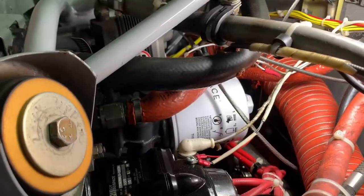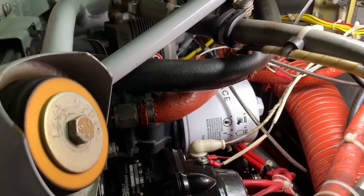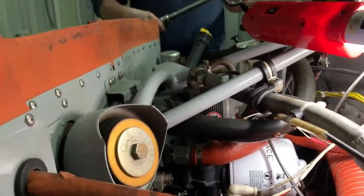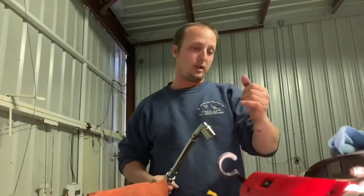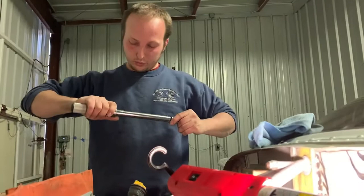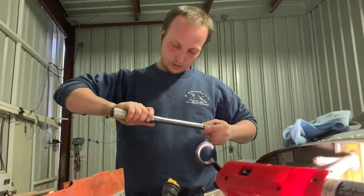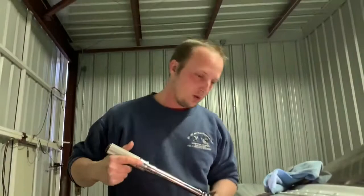Now I've got it started and screwed down where it's touching — I'll grab my torque wrench. The only thing is I don't have one anymore; I got rid of mine when I stopped working on cars. If you're going to be doing your own oil changes a lot, Aircraft Spruce sells a torque wrench specifically for oil filters — it's basically a big open-end wrench, dual-purpose filter wrench and torque tool, set at 16 to 18 foot-pounds. It's low clearance, about a hundred bucks.